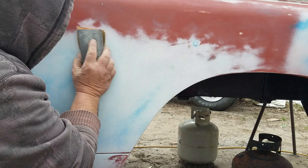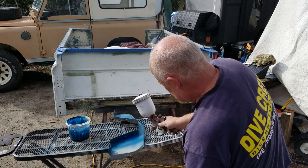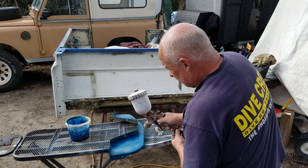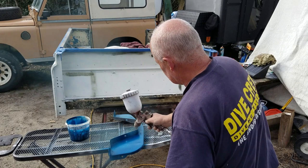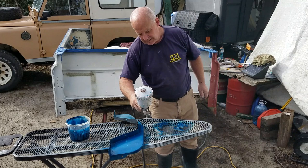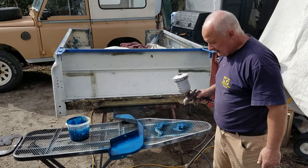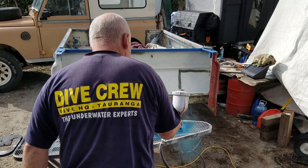When I'm painting I always paint the small bits first to get them out of the way — it makes sure the gun is spraying correctly. There are a lot of adjustments on the gun: you can adjust the amount of product coming out, the air pressure, and the air volume. Spraying small parts gives me a chance to dial the gun in and get it going how I like. While I'm painting something I'll also play with the gun as needed — blow the paint further to get it into cracks, or fan it out wide to get a nice finish on a big panel.